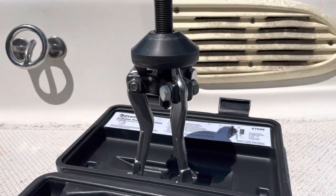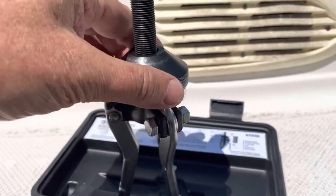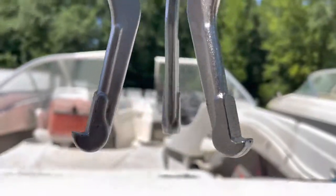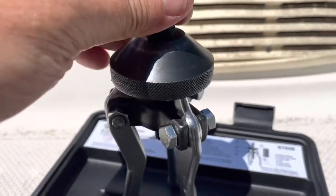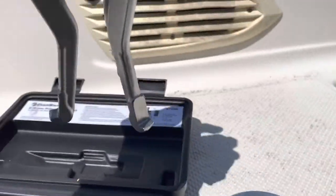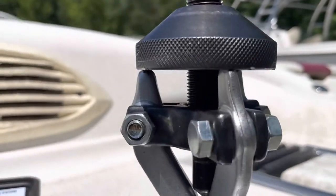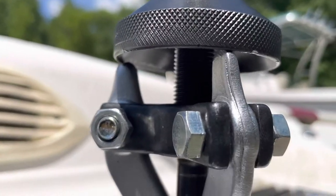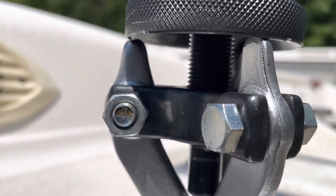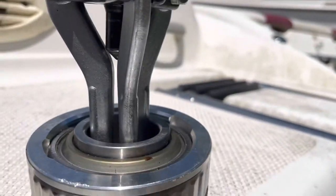Normally what you do is take this piece that comes with the tool, flip it over so the mushroom is facing down — the underside is a cone and it grabs those little fingers and pushes them outward. However, with this gimbal bearing, even when the cone is all the way out it still will not fit over the fingers when the individual teeth are inside the bearing. The gimbal bearing is just a tad too small, so those fingers will not completely fit under that cone. It's not really being pushed outward, just pushed down, which means this mushroom device really won't screw any tighter — so you can't use that mushroom device with this type of tool.